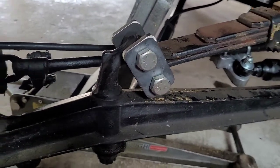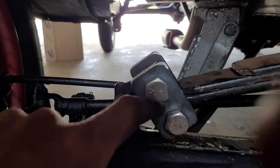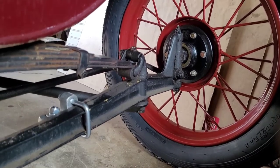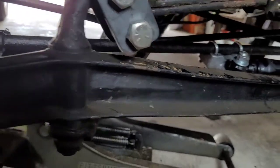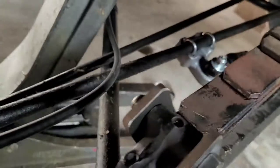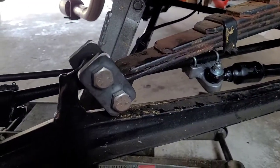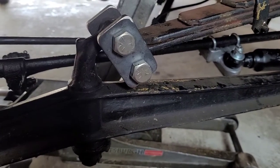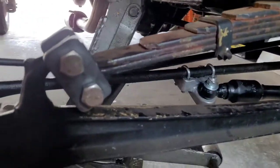Okay, and with the magic of television, you will see the new one is on over here. My center to center is exactly the same as the factory one. I traced it off of the plate and off of the back plate, so the geometry is the same. So all I gotta do now is get a hair longer bolts here and drill some holes in those bolts. I don't know if I'll use castle nuts or all metal lock nuts, but regardless, one down, and all I gotta do is drill the holes for the other side, and we can throw that side together.